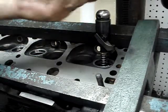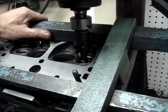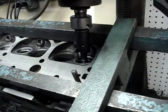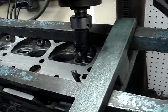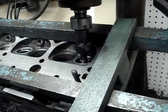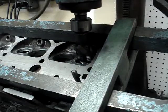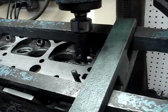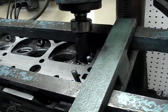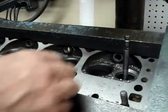We'll put the appropriate driver in the machine here and we're just going to come down. Now this cutter has been located with the fixture so that it basically matches the valve that's going in here. And this cutter has all the angles on it that we need. It's actually a three-angle cutter and we're doing what we call a three-angle valve job. We're actually going to put all three of those angles on that seat. That's how we do it.